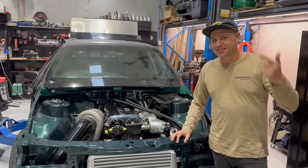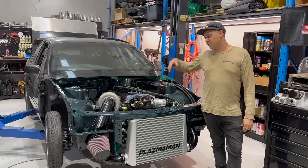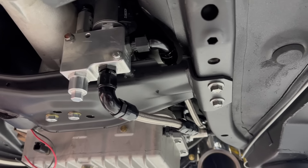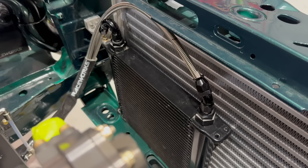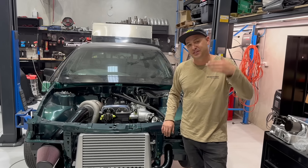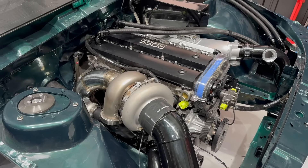I've also been a very busy man - we've been to Jamboree, we've been to Sydney for World Time Attack, I've got other projects lined up and I'm trying to spend as much time with my family as possible to keep my head in check. So lots of progress has been done on Kevo. We're nowhere near first start - there's still heaps of work to get done. Just today before filming this outro, I tidied up the dump valve on the back of the Powerglide and had to make up some new lines out of Raceworks Dash 8 200 series. I then made the auto trans cooler lines up to the PWR cooler at the front, made out of Dash 6. There is no wiring fitted and there's still heaps of plumbing to get done. Thanks to all my mates that have come around to lend me a hand.